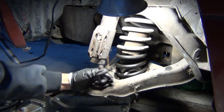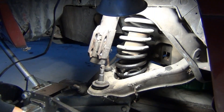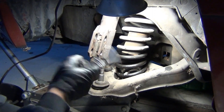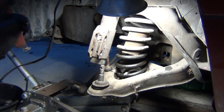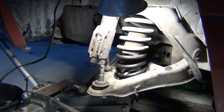If it's good — and this one's not terrible, but it's not ideal — I can tell the control arm bushings are worn out so I'm going to have to remove the arm. For that I'm going to have to remove the spring. There are two bolts holding the arm in place. Before I do any of that, I have to disconnect the sway bar link. I'm going to go ahead and do that right now.